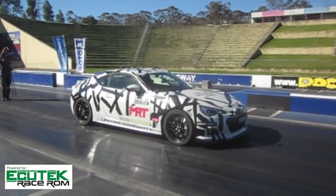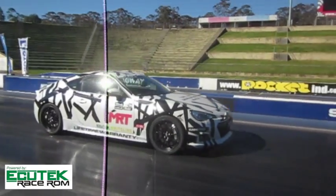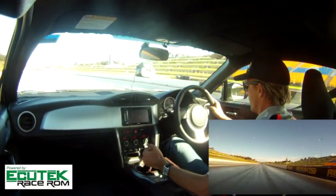All I do is keep my foot flat to the floor on the accelerator, let my foot off the clutch, and the car will launch out with a limited amount of wheel spin — allowing me to choose the level of wheel spin at a certain amount of grip for the tyres I've got. Which is a fantastic way to completely launch the car.